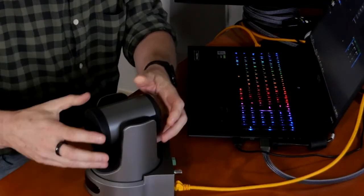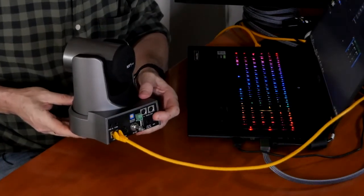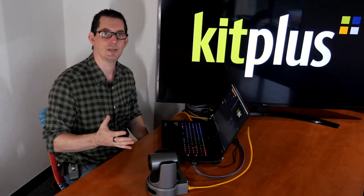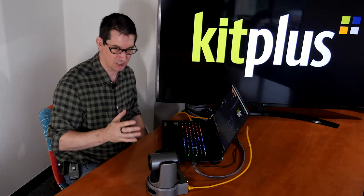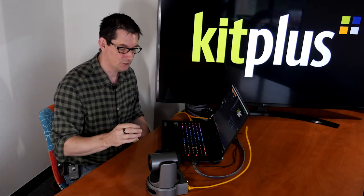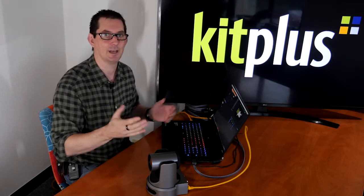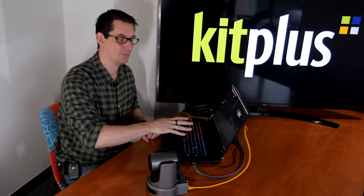First things first, I want to take the lens cap off — we don't want to be holding the camera while it's trying to move — so we take the lens cap off and switch it on. As soon as it switches on you can see it goes through a quick diagnostics. Once it's connected to the network it will get an IP address automatically. If it doesn't, you go into the menu settings or the web interface and tell it to connect automatically. You can do that by going to the default IP listed in the manual — basically get your laptop on the same IP range, change it to dynamic, reset everything, plug it back in, and you should be good to go.